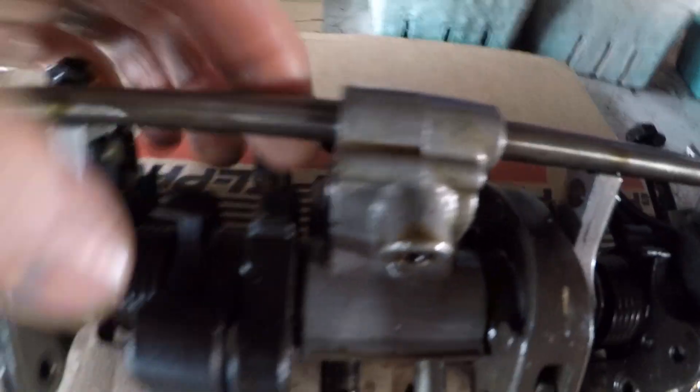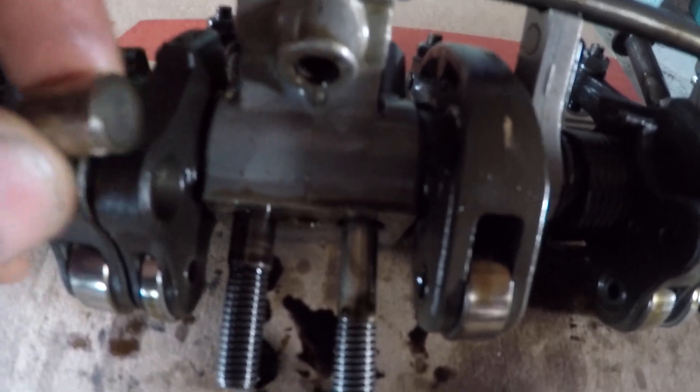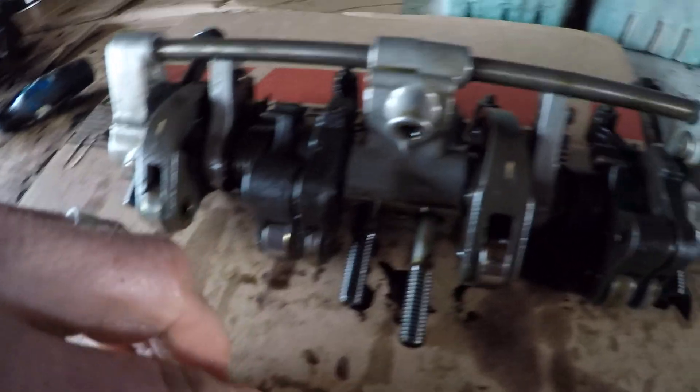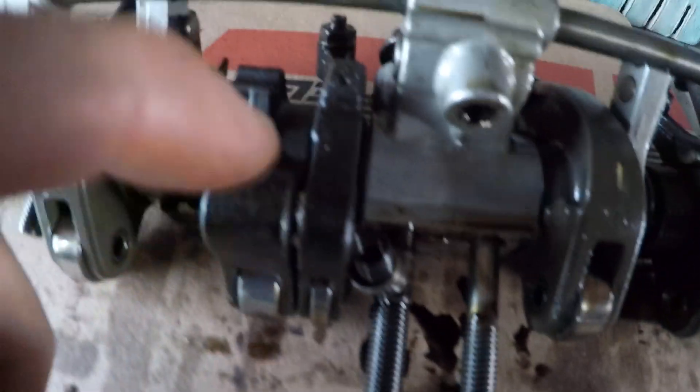This pin here is the one that gets pushed out when oil pressure increases. The spring-loaded pin is locked in here and helps push things out by default, but when oil pressure gets high enough that the solenoid pushes these, this pin actually gets pushed into this one so they combine. What we're going to do is reverse the order — put this one all the way in, then put the spring-loaded one on the outside so it just holds that pin, which is already locking things into place.